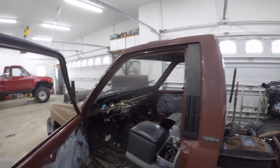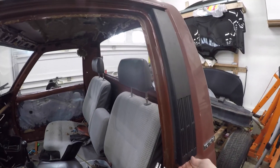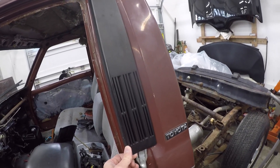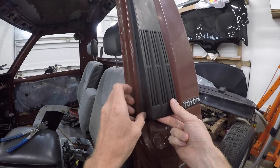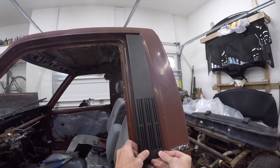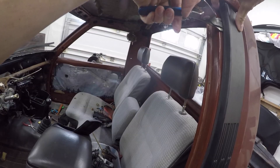So this is my lifted 2-wheel drive '87, and it's going to be a B-pillar trim donor. I'll start on the bottom clip first — it's the easiest to get to. There we go. Make sure not to lose these rubber gaskets. See, there's a little room for the trim to slide up and down on the clips. I find the mounting points break less when the trim is slid up as far as it can go.